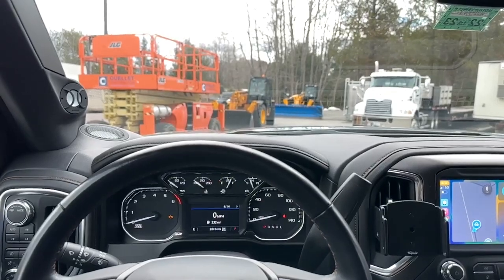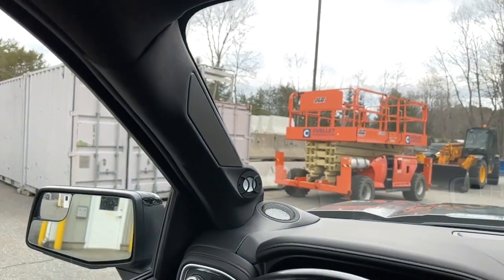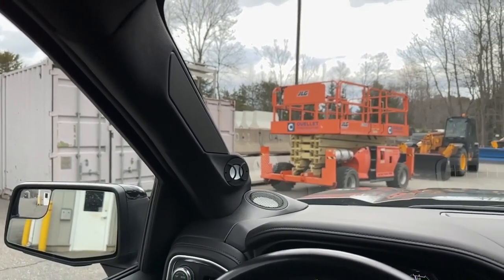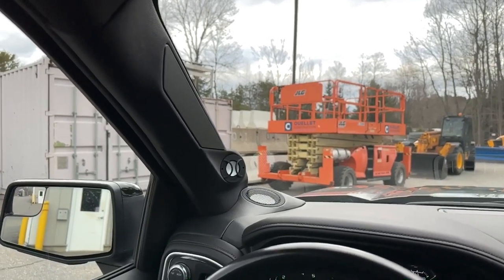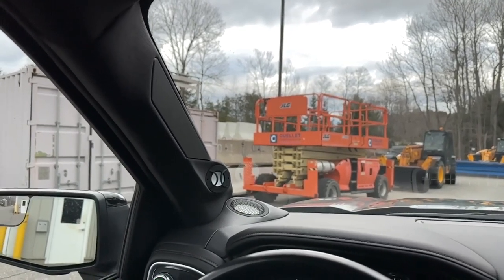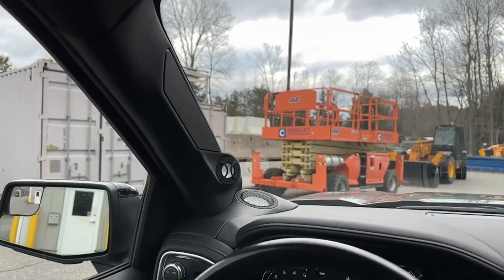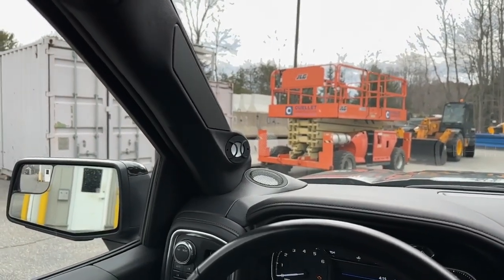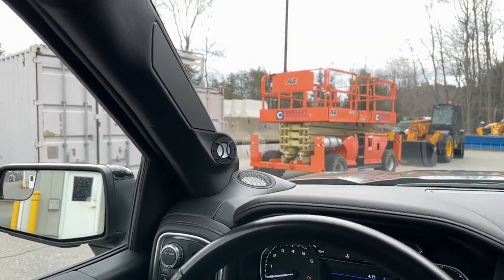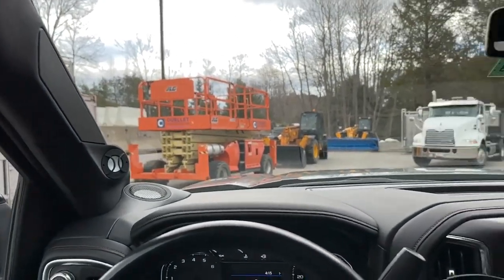All right, so you're catching it up in the upper left-hand corner. These are the beauties of the Accuton Automotives. The tweeter is the C30 AM, and the mid is the C100. They just do things that other speakers can't. And you have to be prepared to listen to them because they reveal everything. But once they're tuned in, they are just incredible. They run right now, my mids are 240, actually all the way up to 5K. Tweeters are crossed at 5K up. And just do some magical things.